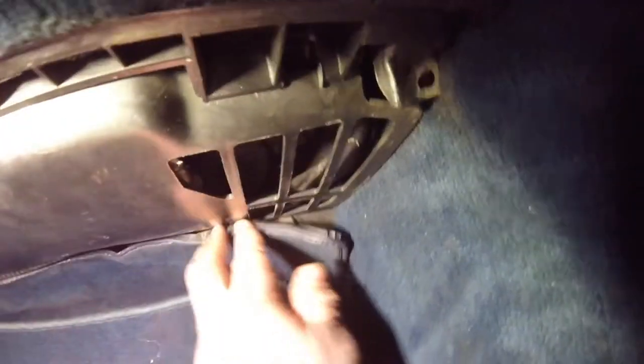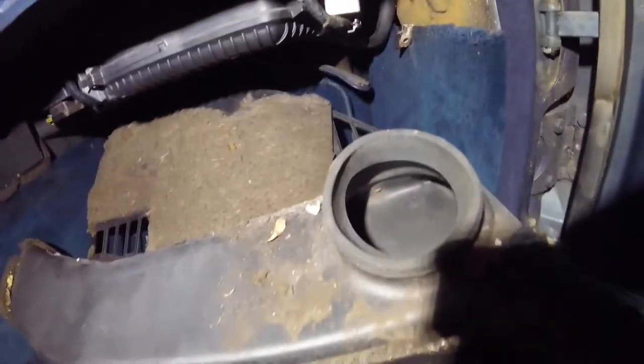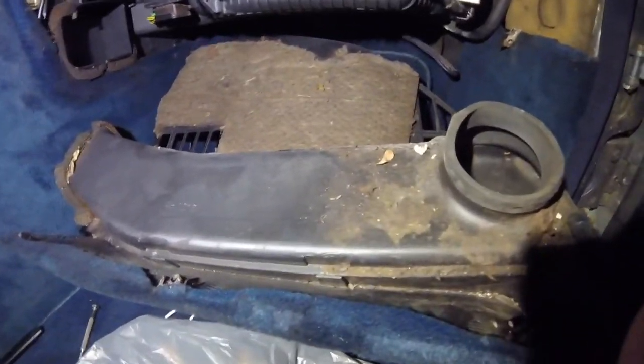Now I'm going to check the blower motor. You've got three screws here, here, and one there, and one under here — undo these. Top tip: when you're going to put this back in, see that ring right there and this tube right here — that needs to fit inside of that ring. Not easy. You're going to angle it in like this and then tilt it up. If you have an older car that sat for a while, you're probably going to find a mouse nest in here, which is what I did. I've been in here already.